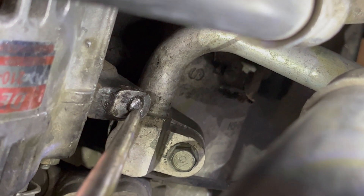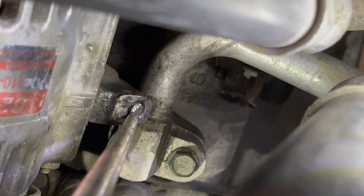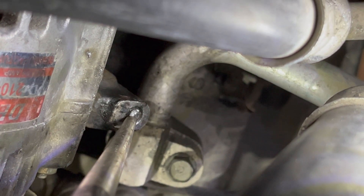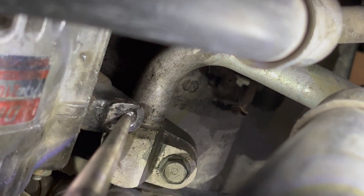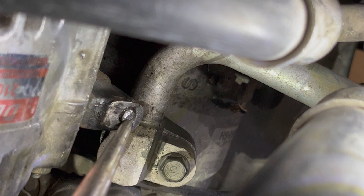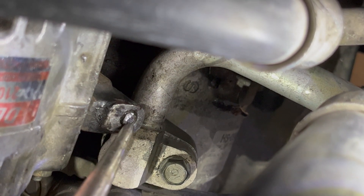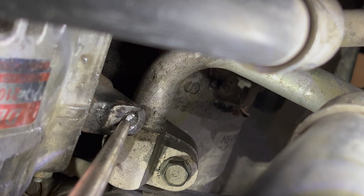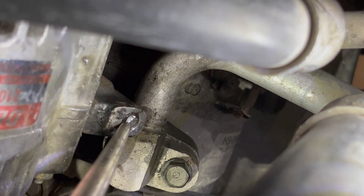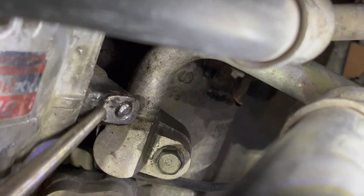This was a very slow and painful process. It took us a little while to get our rhythm and our technique down. You can see in these early parts of the video we were kind of hammering straight down. I don't have a punch that has a nice sharp point on it — that probably would have helped in this case, to dig into the bolt a little better. This is a flat nose punch and we had to use kind of the edge of the punch. That bolt is probably only about a quarter inch wide, so it was really small spaces to deal with.